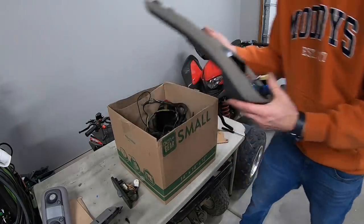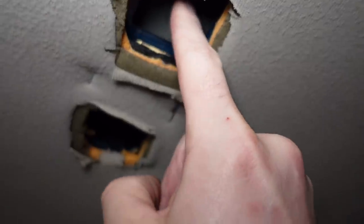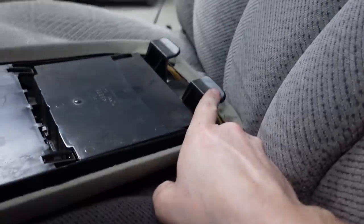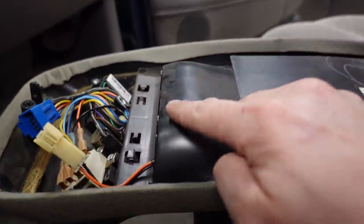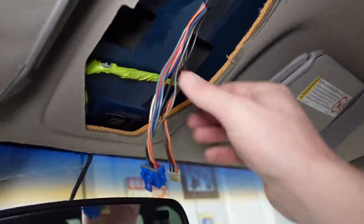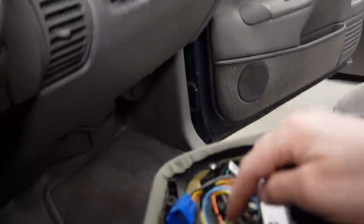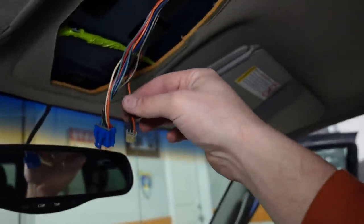There are three chunks in total you're going to have to cut out of the headliner to get the full-length console in place. The rear two - that's to access the little square in the inner metal structure, that's the inner right there and the outer roof right there - and that's what the rear two tabs of the console grab into. The front hole I had to extend a little bit, or if you're going from an extended cab truck with no console you have to cut this entire hole, because this little hump right here that sticks up above the surface is for the dome light to go up in. Now obviously there are some wires up there that you want to be careful of, and I did have to switch over my HVAC controls. But lucky day - this plug right here is for the map lights. The Suburban already has the power harness for the map lights in place, so everything is going to work exactly like it would have from the factory if this was an option.